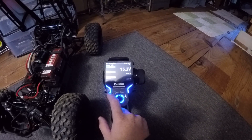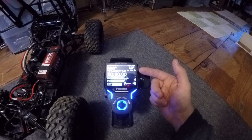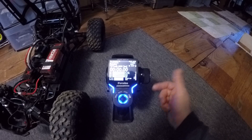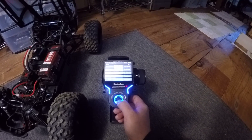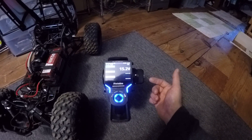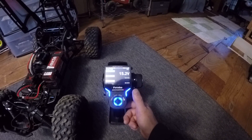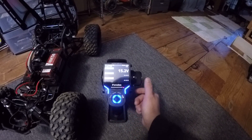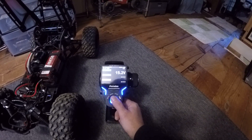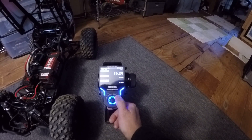I've yet to actually manage to put this info where the receiver telemetry information is — you might be able to do it, you might not; I haven't tried too hard. For right now, going about it this way is sufficient. I'm going to try to reconfigure this and switch the screen to just show BEC voltage and ESC temperature, because those are the only things I really care about. There are three pages — this is page two, page three — then it cycles back to page one.